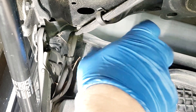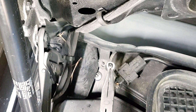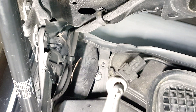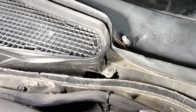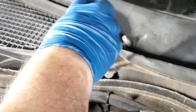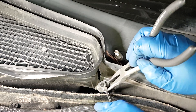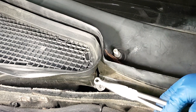The rain deflector is held by four plastic fasteners on the bottom side, and a very tight perforation below the windshield glass on the top side. First remove the four fasteners. If you lose them or they're broken, you can purchase a set of 240 fasteners of all kinds from Harbor Freight for 13 bucks — I'll have that in the description. If they don't come out easily, force a flat head screwdriver underneath to make room, then insert hose pliers underneath to force them out.